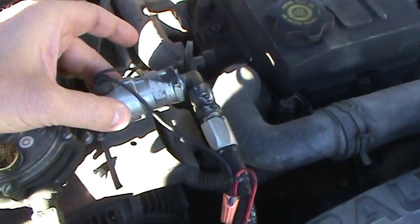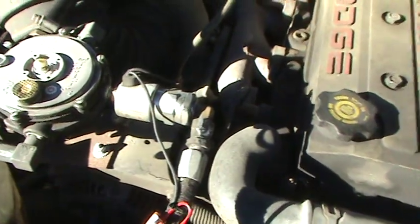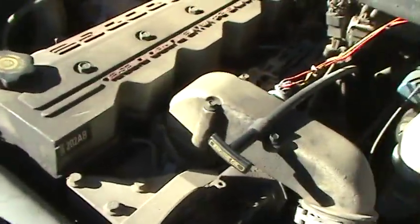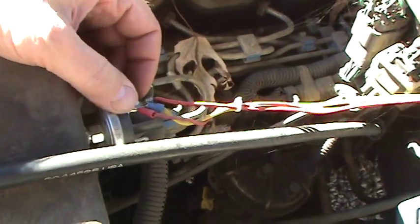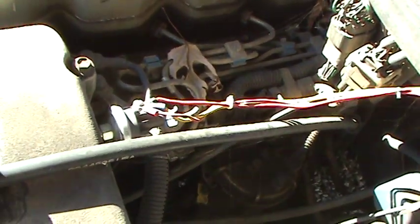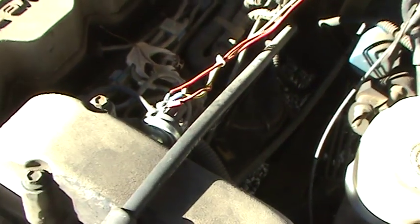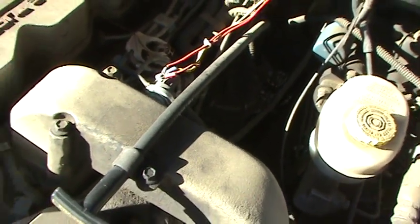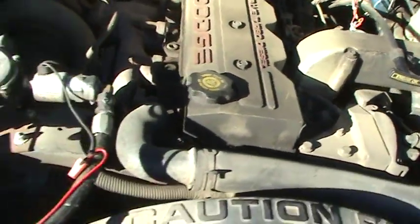This little piece right here is a 12 volt shutoff. If it doesn't have power to it, it doesn't release any LP. This little piece right here is a pressure switch — the turbo has to build up a certain amount of pressure. This one is a 4 PSI switch, so unless the system has at least 4 PSI in it, the regulator will not release LPG. So it's got a few safety features on it.